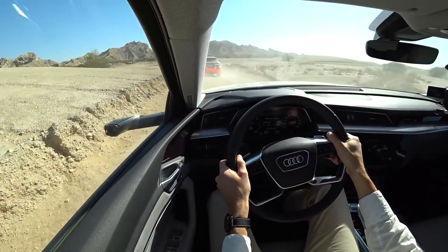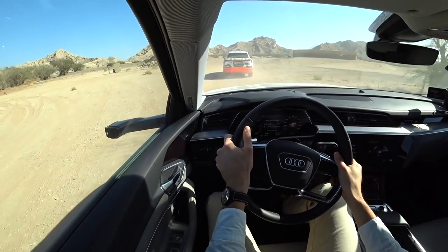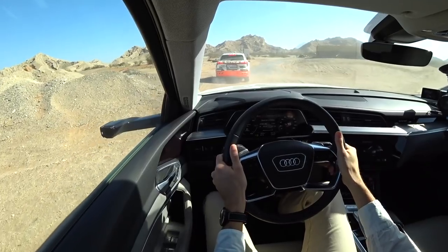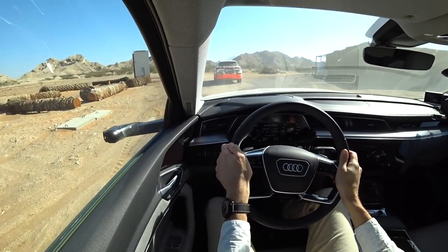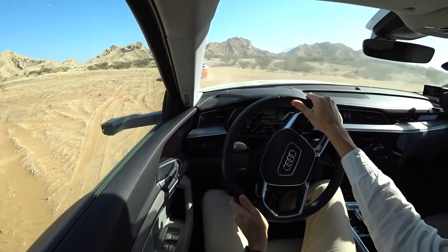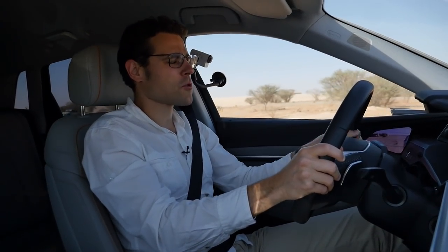Here today, some slower off-road riding. Seen also some angle change here, for example, just to get a feeling for that vehicle. So it's also easy to control off-road. The steering is light, but still offers you a feeling that you actually always know what to do. The air suspension, remember that when you put an air suspension higher, you lose comfort because you have less negative travel then. That's a very interesting aspect, but still, you feel that you're driving an off-road vehicle with an air suspension. Because all of the bumps here, they are evened out quite well still.